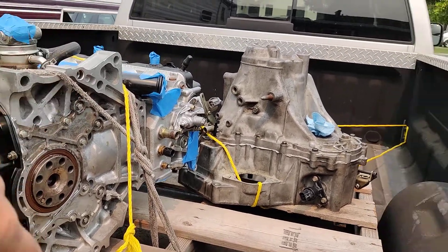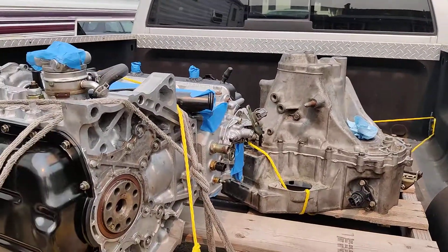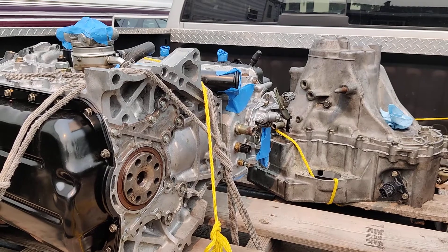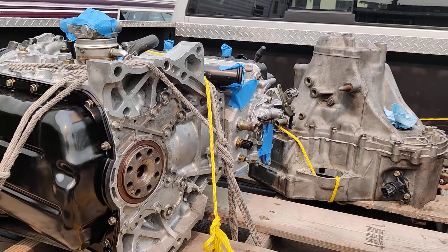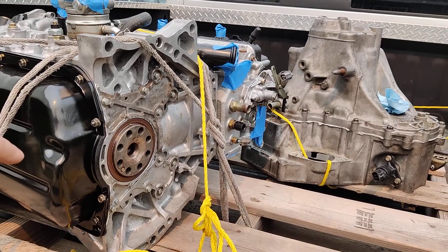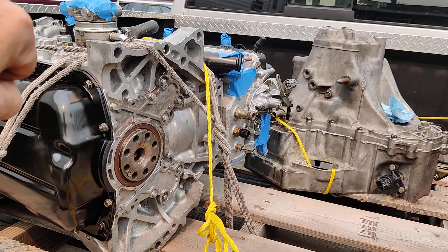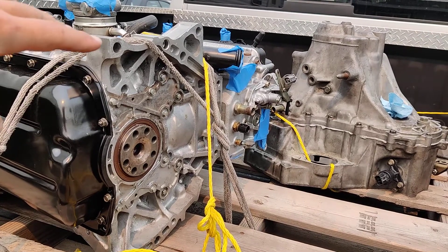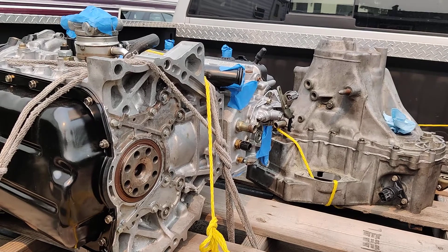It's a street motor designed for the Civic, so this is going to be something that lasts. Going through titanium valve train would just not last, right? Tool steel by contrast is heavier and less likely to rev as high, but it will last significantly longer than titanium retainers would. That's why I opted to go with those.